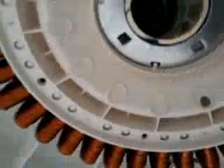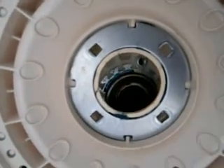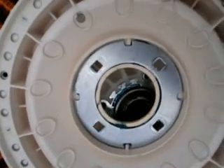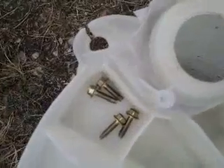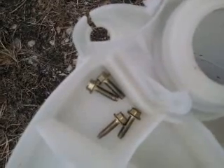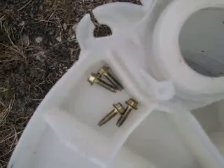You'll see four bolt holes there on the little silver ring. You'll need a 10mm socket - or 3/8 will probably work - to get those out. Unfortunately they didn't mention this, but there's another one of those rings on the underside, and mine fell in the dirt because they didn't tell me anything on the website. So that's something you'll want to notice - there's going to be another one that may fall in the dirt.